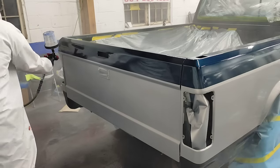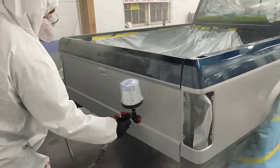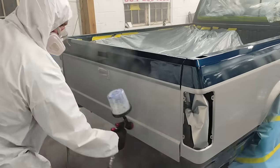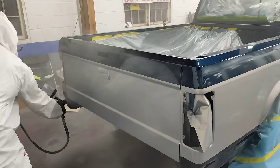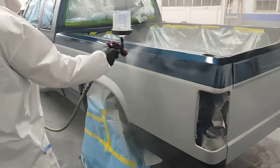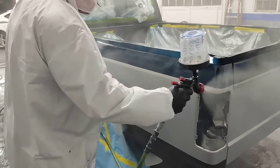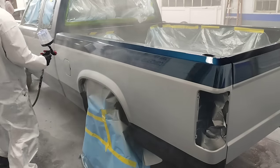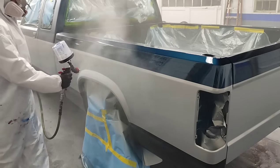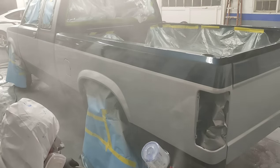And then the second coat, you go a medium wet. And then if you do a third optional coat, you can go another medium wet on that coat. If the temperatures are a little bit hotter, you can go a full wet as opposed to a medium wet. But I find the one kind of dry, tacky coat, but still smooth coat, and two medium coats is usually the way this product looks the best.